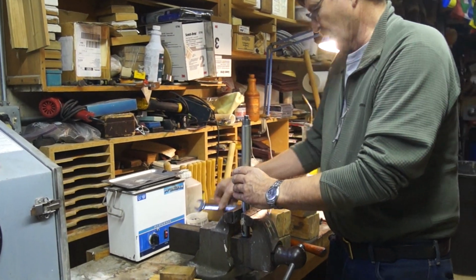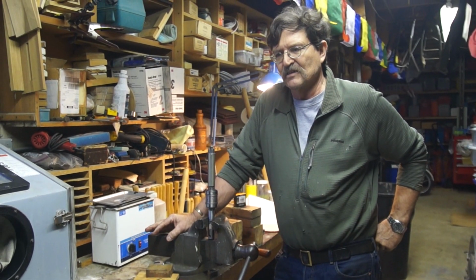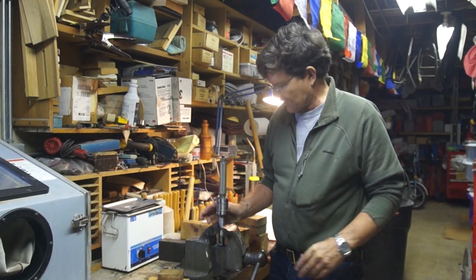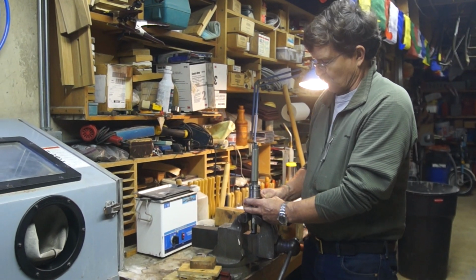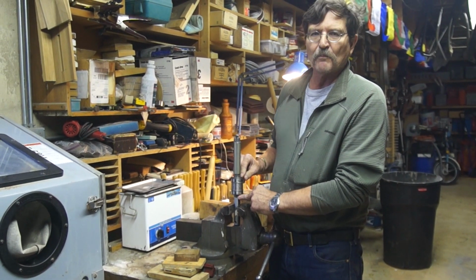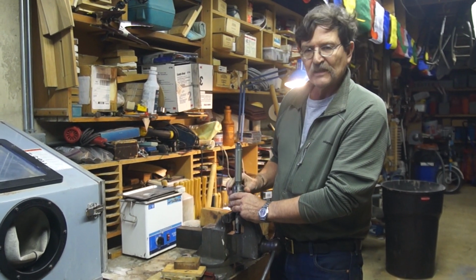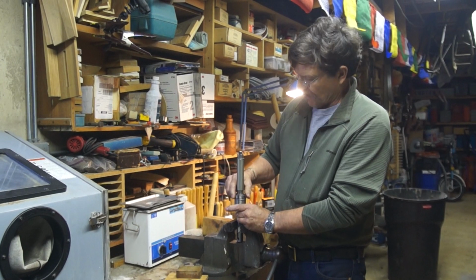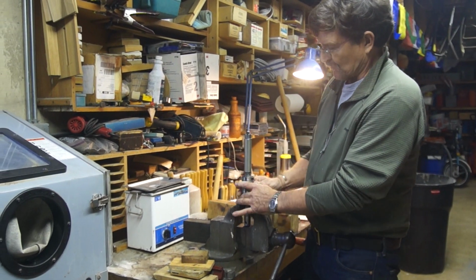Okay. Dwayne Asherman has what he calls the shake the wheel test. Bob Fletcher, aka Snowbum, on his site has a way of testing it using a scale. I use finger pressure. You put both thumbs on it and see if it moves. What that wedding band does is it holds the two inner races apart so they do not bottom out on the outer races when you tighten up the axle. You need a little bit of play there. Otherwise you will burn the bearings and you will heat. In the later aluminum hubs, you can heat that outer race up where it will spin in the hub. And then you need a new hub. So basically that's what we're trying to do.